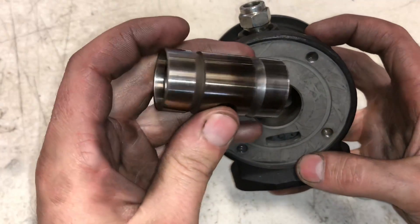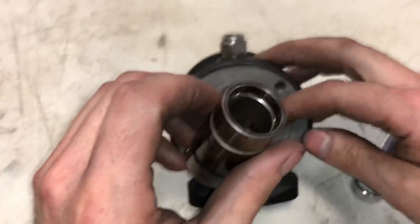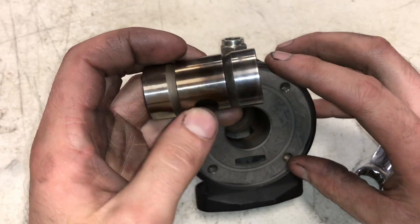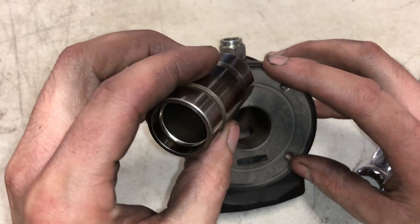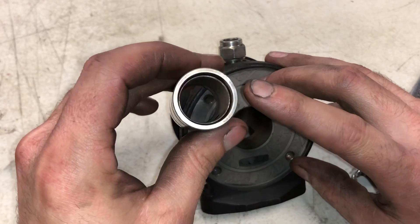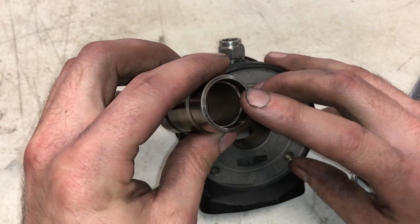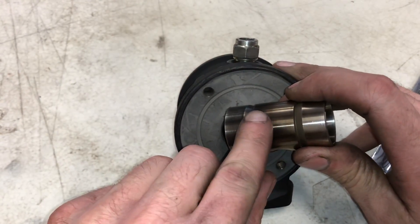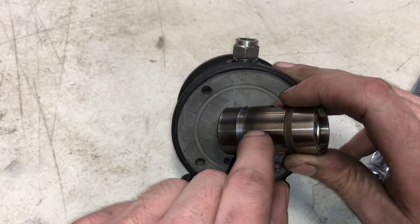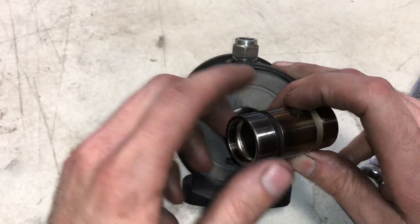This cage is empty. This piece can be taken apart when the sleeves and balls are in it, but you don't have to do that. A lot of times we take them apart so that we can clean behind them. The way to take these sleeves out with the balls is to hit the edge of the sleeves to press this side out — put a screwdriver through here and press or hit it out — then go to this side and hit this sleeve out in that direction.